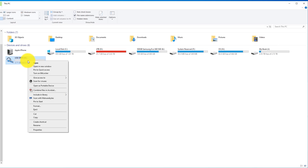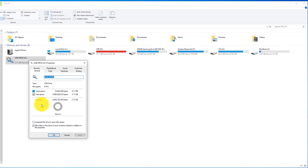However, if you right-click your USB drive, hit Properties, and under file system it says NTFS, you're going to have to reformat the drive so it works with the PS4 update. Otherwise it's just not going to work. I'll show you how to format it quickly.